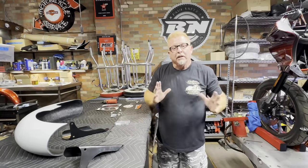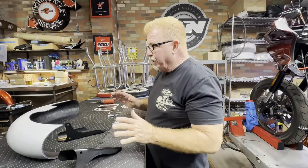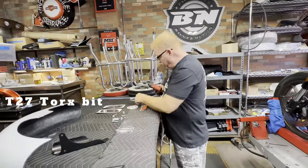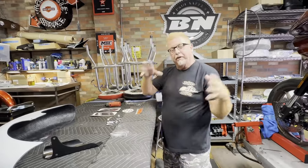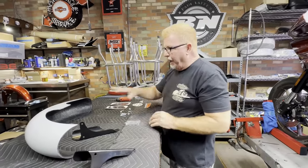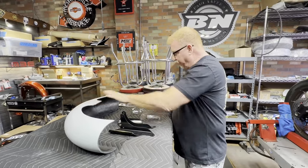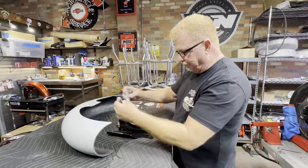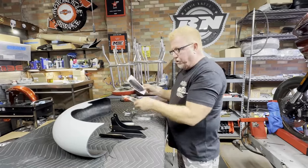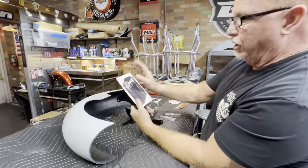Basically, you're just going to put everything together loosely, slide it in place, then torque these four points, then center the fender while it's loose, and then tighten the fender bolts. What you're going to need is a little variety of half-inch wrenches — I've chosen my favorites — and you're going to need a torx bit to undo the stock button heads that hold your current fender to your fork. Go ahead and remove your front fender and retain the four screws. Then loosely assemble our inverted fork adapters to our custom sport fender. In the kit you'll get the hardware you need, a pair of spacers that go between the adapters and the fender, and a couple of shop stickers made in the image of the debris guards to dress them up.